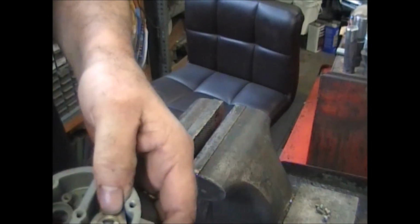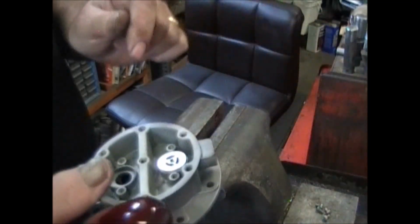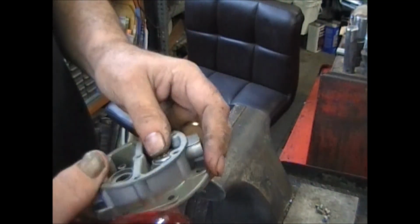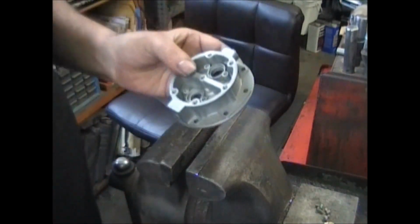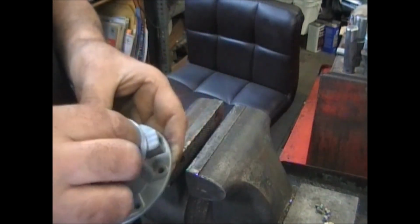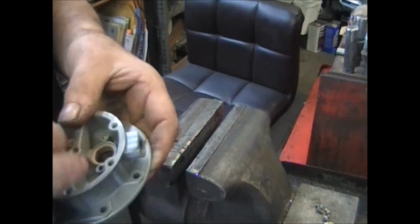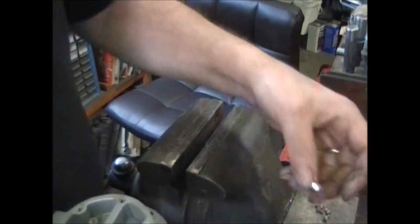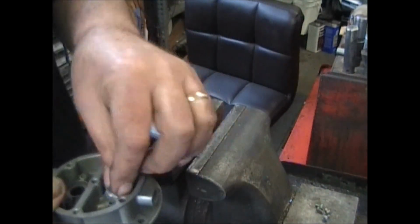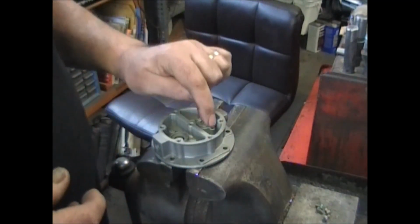It wouldn't hold the valve down. This doesn't sit high enough. Even with putting one gasket in there, it doesn't sit high enough. So on this particular one, what's needed is, yep, you guessed it, 2 gaskets. Put 2 of them in. Now the valve sits up high. It's got to sit up higher than those 2 pieces of casting where the screws go.